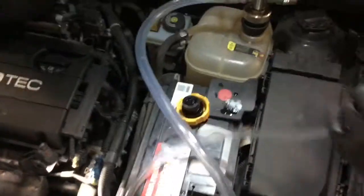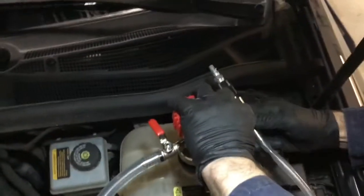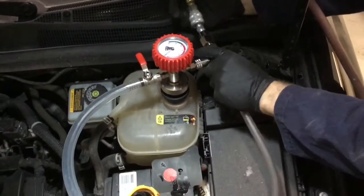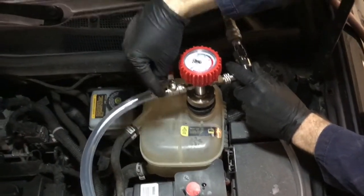We are seeing all the components here of this vacuum cooling system filler, sometimes referred to as a coolant lift. The technician is assembling the tool as per the directions that came with the tool and installing an air hose to the end of this tool. This tool uses the Venturi effect to put a vacuum on the vehicle.